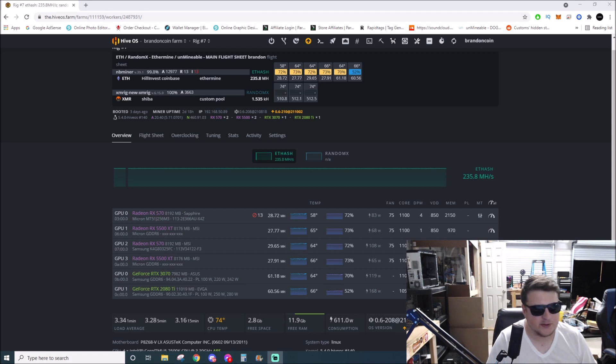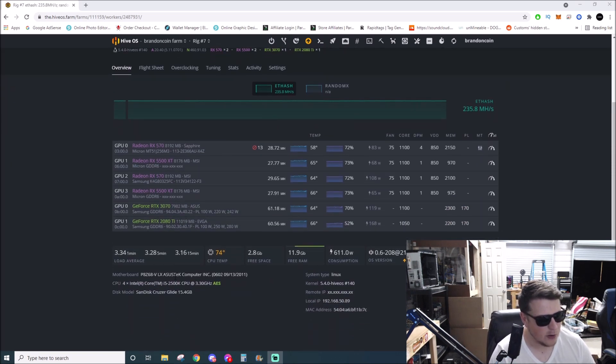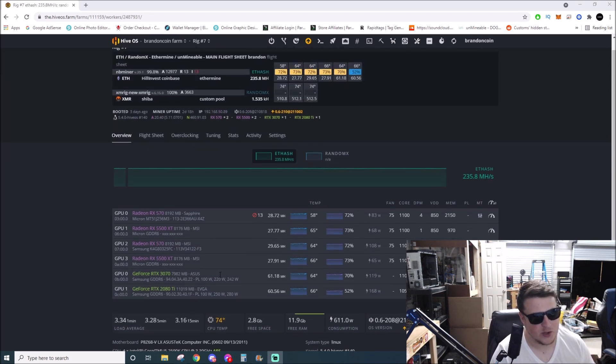With the power of YouTube magic, we're back — fast-forwarded a couple of days. This rig has been up for two days and 18 hours. I have two RX 570s, two RX 5500s, a 3070, and a 2080 Ti — a good range of different cards all on this old Intel Core i5-2500K motherboard. The splitter is recommended for Sandy Bridge or newer, but there haven't been reports of it failing on older stuff, so if you have anything made within the last eight to ten years you should be fine.